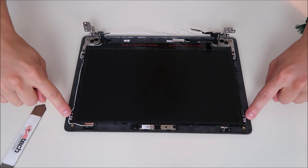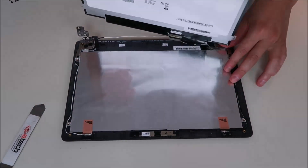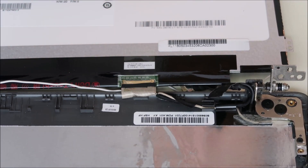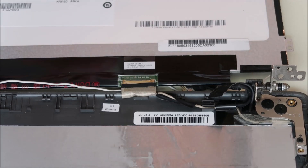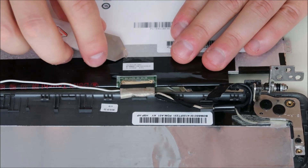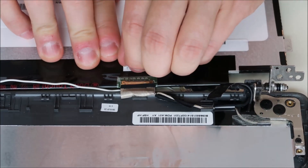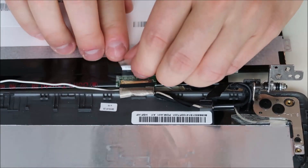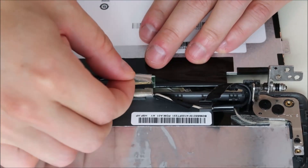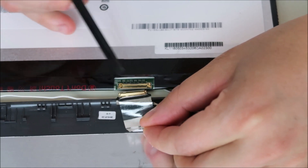There's your LCD. I see two screws holding it down on each side. Carefully slide that up. Let me zoom into this connection so you can see how to disconnect it. There's the other side of your LCD cable that came from your computer, and it's plugged in here to your LCD. We're going to take a small flat pry tool — it's usually held down by tape. I'm going to slowly peel that tape up. Go nice and slow, because these LCD cables and ports are very easy to break. Slowly, carefully work toward the port and the connector. Once the tape is free, bend that back to give access to the port. Use the plastic pry tool, push one end out, and it snaps off like that.